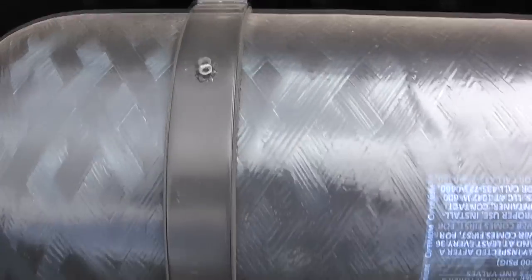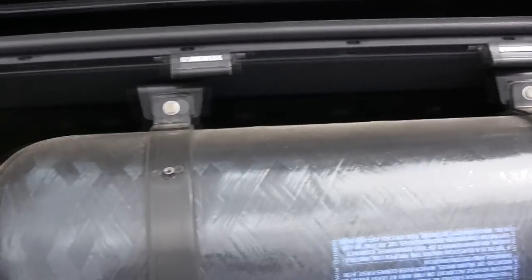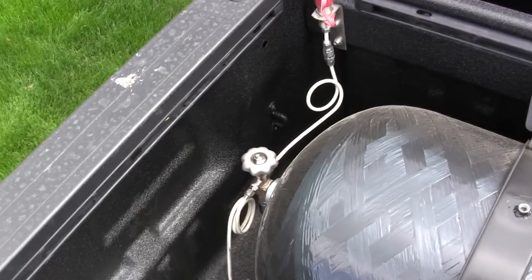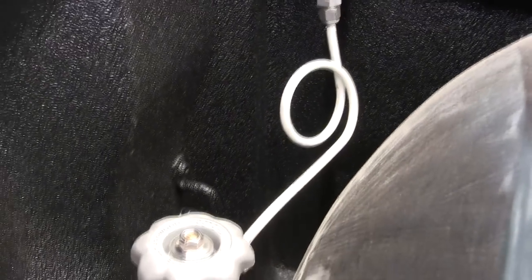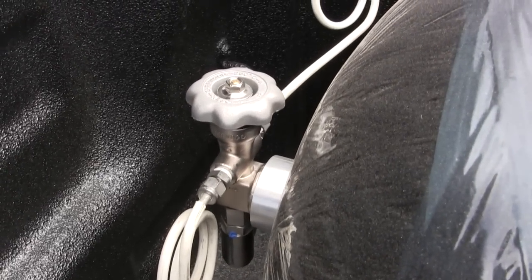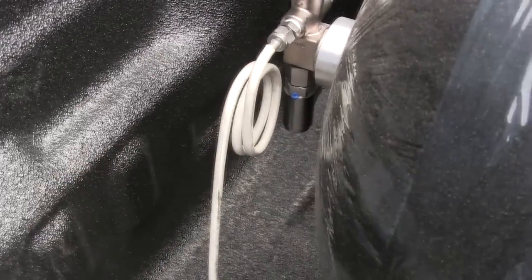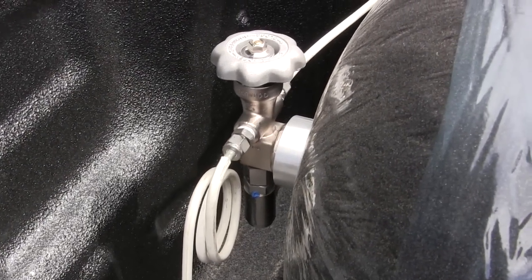These brackets are heavy duty, custom to the cylinder, and must be fastened securely. Again, the cylinder must be installed according to NFPA 52 guidelines — I believe it's chapters 4 and 6 that cover all this. There's the filling unit, and there's a stress loop. The stress loop is required by law; it just gives a little flexibility in the event of an accident so you're less likely to tear this high-pressure fuel line.